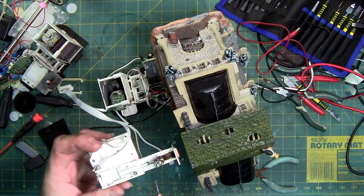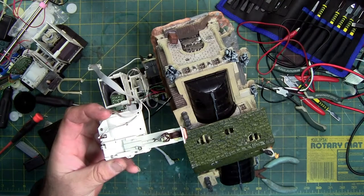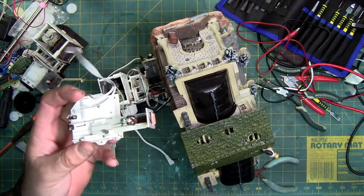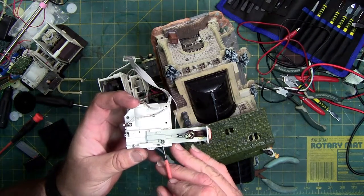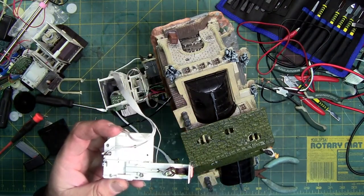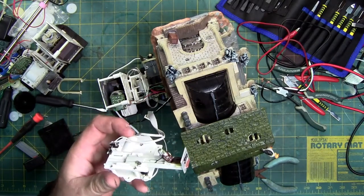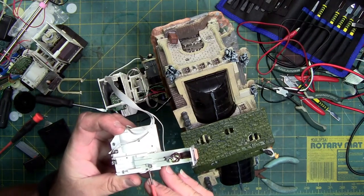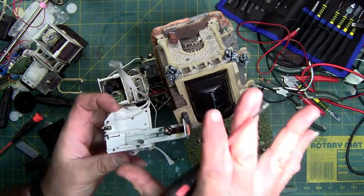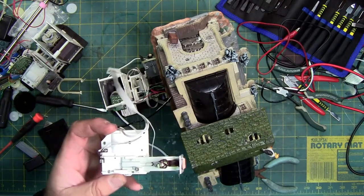When it pops up, it jerks — I can't fix that. It's jerking because the magnets are worn and it's allowing it to go too far forward. I don't have magnets of this size; I've never seen magnets this small or rectangular, and if you ever cut a magnet, it's really hard to do. The little bit of jerk is okay — it's not overextending because the micro switch stops it. It's not going to break the gears because the micro switch stops it. As long as the micro switch doesn't fail, the gears won't fail, technically — dry rot and heat-related things aside. He lays down relatively smooth, just pops up a little more violently, which gives it more of a spooky jump scare. But it works. Unfortunately, it'll never be OEM because it has wear.